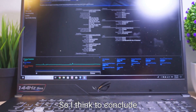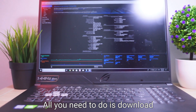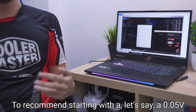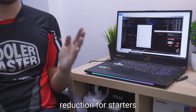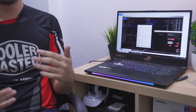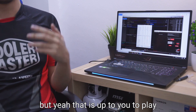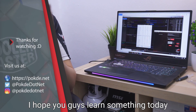To conclude, the ROG Strix Scar 2 does not need you to void the warranty to improve thermals. All you need to do is download Intel's Extreme Tuning Utility — we will put a link below — and just undervolt your laptop. We would recommend starting with a 0.05 volt reduction, then running benchmarks to confirm stability, and going from there. Sometimes you may run into something that is stable in one benchmark and not in another, but that's an inherent risk with overclocking and undervolting. That's all for today's video — I hope you guys learned something today.